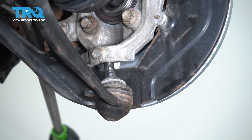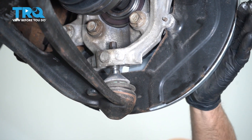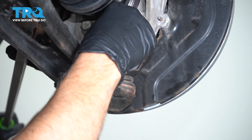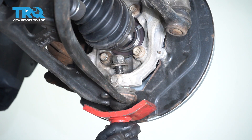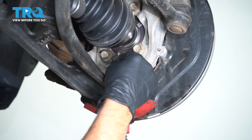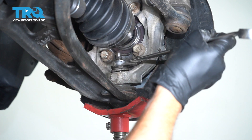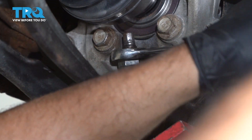Watch your fingers — you want to be careful. Get that to line up and put the nut on before the ball joint is all the way to the top. Underneath, I'm just gonna put a pole jack and put a little bit of pressure under the ball joint so the stud stays and I can tighten that nut down. If not, I'll have to put a wrench on the top of the stud to prevent it from spinning. If you can get a torque wrench in there, torque this to 148 foot-pounds.